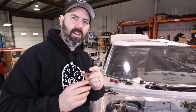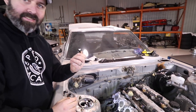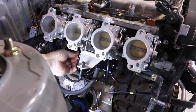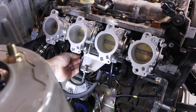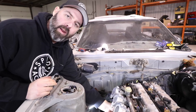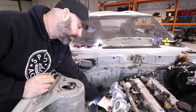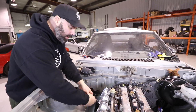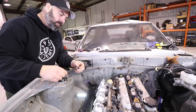We're really only going to use the MAP for cruising throttle tip-in and cruising behavior. It's not going to be used much for tuning an ITB setup like this, but it should smooth things out a bit. It's worth having it in the mix but it's not a make-or-break deal. We also have an idle speed control motor and a little sub-harness going in — that's another upgrade ordered from PanicWire. It actually uses a Ford idle speed control motor, which will give us the best possible tunability for idle quality. We'll show you that in a future episode.